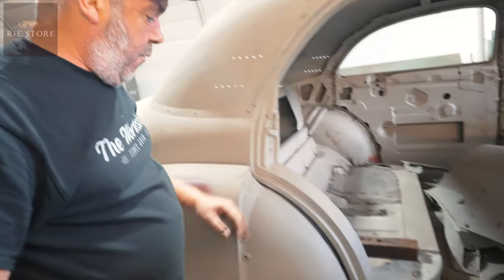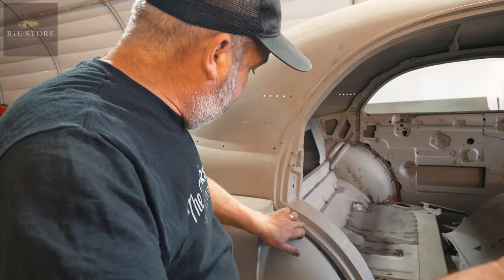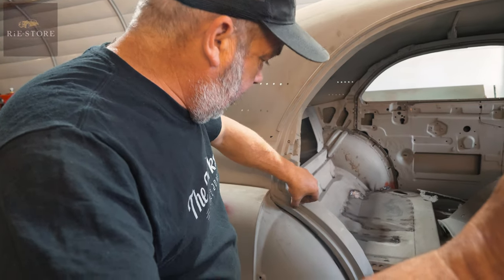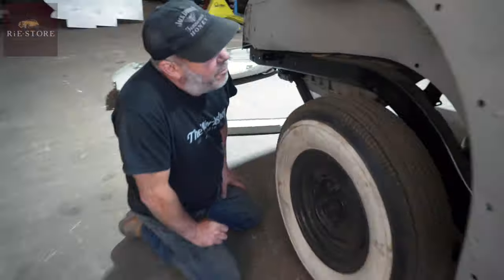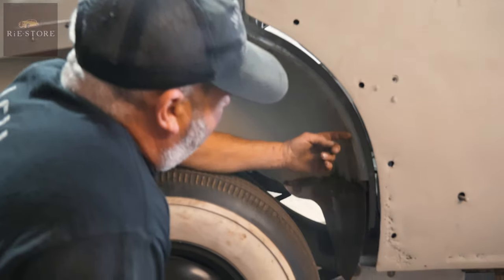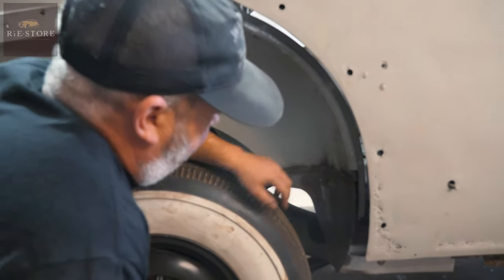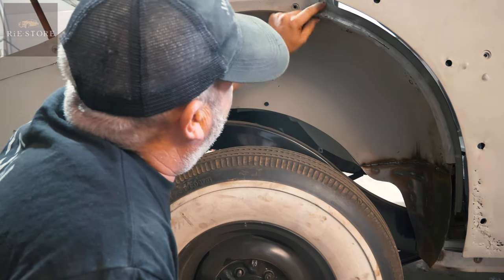I think what we'll do is take the back wing off. Remake this piece, because it's all knackered anyway. So I can't really remember, it's been so long - all of that edge is going to have to come off. That's lead. So we'll cut all of that out to plate that up, we'll have to repair that corner. At least we know where we're going now.